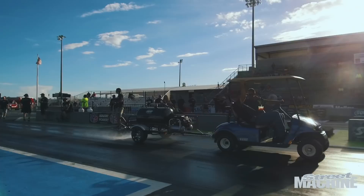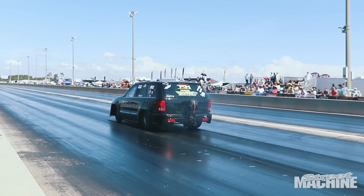Because the radial isn't spongy, the track needs to be really sticky compared to what it would be with a traditional drag slick. The advantage of the radial is that there's effectively no tire shake — you can still get them to shake, but mostly they never shake. However, there's a very small margin: put it right on the limit of grip, and if you go beyond that, it just blows the tire right off. A slick, being springy and spongy, acts almost like a damper — if you make a little mistake, it will recover and still go down the track. With a radial, if you make a mistake, it just blows the tire off.